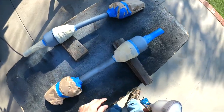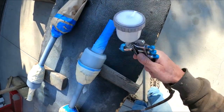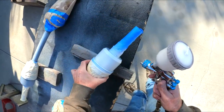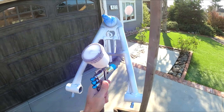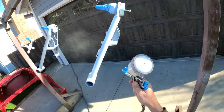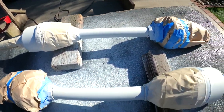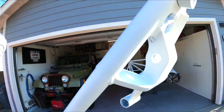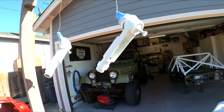Come back over here. Yeah, it's already tacked off, so now I'll put on a heavier coat. We'll start this side out here first. Should have primed this stuff, but we got another coat on and that should just stop the bleed through. So we have finished with the base coat. As you can see it looks pretty good. It's a little cold out here, probably mid-upper fifties — this is not ideal to paint in and it has not gone on very well, but you can see it should look very nice. So we'll let this dry for a little bit and then we'll throw some clear on.